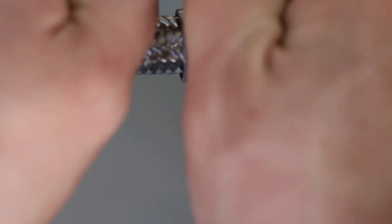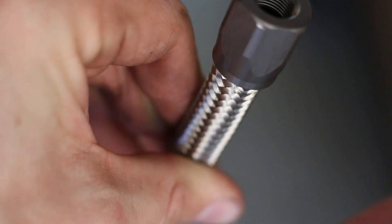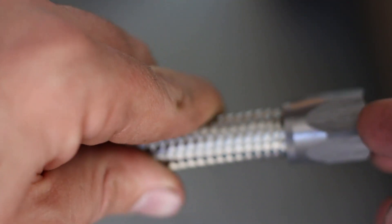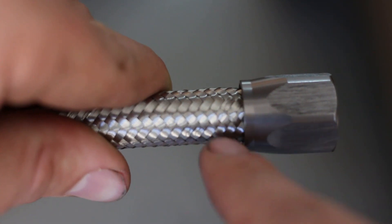Now what I'm going to do is take the hose end of the fitting itself and just slide it over. You want to make sure it's all the way at the bottom — it can be a pain if you have a cut that's too messy, but this one was clean enough where I could actually take the tape off. Now you take the end that screws into the end that goes on the hose, and at a certain point...